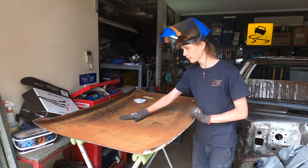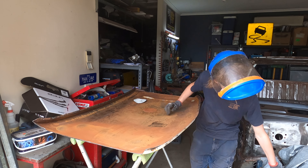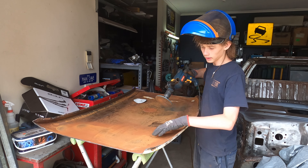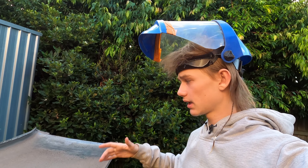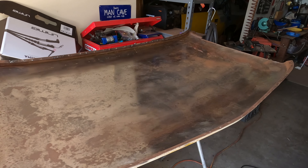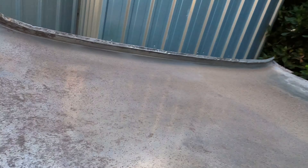It's come time to bare metal the skin of the roof — it's got a fair bit of surface rust and we're going to make sure we clean that all back. I've come in with the drill with a flat disc pad and it seems to be working all right. I was using those flapper discs to clean up the roof but it didn't really do a good enough job because there were still lots of little pitting areas we could not get off.